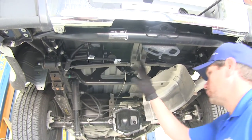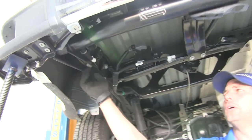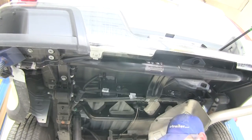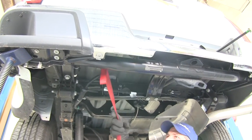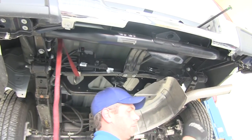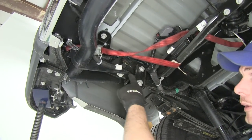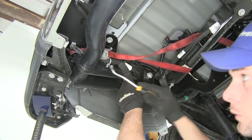To begin our installation, we've removed our spare tire — it usually lives right here. To do our installation we need to remove four bolts: two down here and then two up on the side of the frame rail on each side. Those support the cross member that runs across the back, but they also support the bumper. I'm going to use a couple of cam buckle straps to make sure we're supporting our bumper and pulling it towards the front of the car and also that we've got it supported from the bottom. I'm using a couple of pole jacks because we're working on a lift, but you could use jack stands at home. Right behind the rear spring perch we're going to see those two bolts that we're going to remove, but right here on that cross member there's a little Christmas tree fastener that holds some wiring in place.